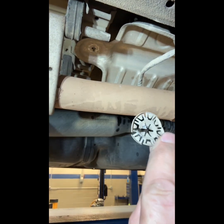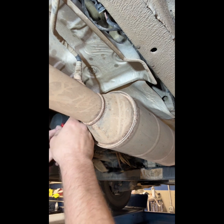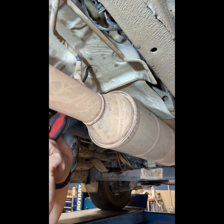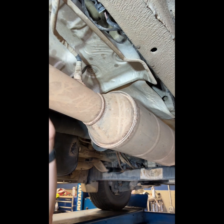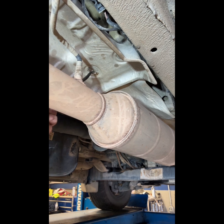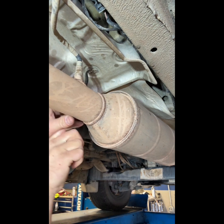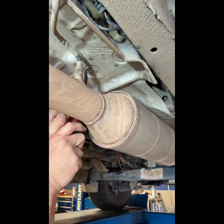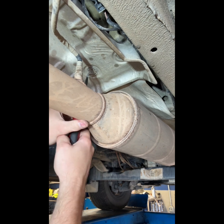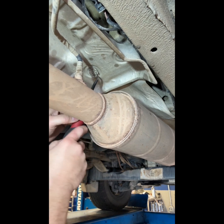It's gonna damage when you take it off, so you're gonna need three new ones. I'm gonna get these front retainers off — just hook into it, try it down on one side like so, and just kind of bend it down and start to spin it off. Be very careful, because this thing is real sharp and it can cut you. If you're pulling on this hook tool and it comes loose, it can hook into your hand. So be very, very careful.